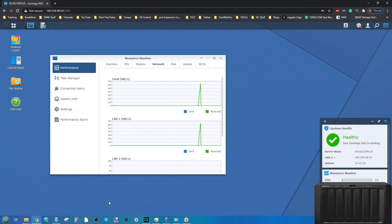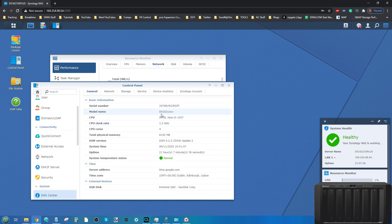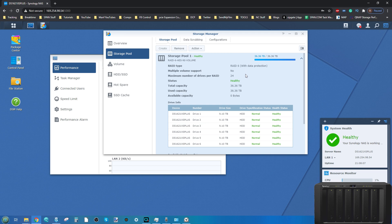There's probably a lot of background noise - fans on the laptop, dedicated GPU, and fans from the NAS itself combined with the enterprise-grade hard drives. In the control panel it is the DS1621xs+, a four-core Xeon-based NAS with 8GB of memory. In the storage manager we can see six WD Ultrastar 10TB enterprise drives. I've not enabled caching - that's for another video. These six drives are in a RAID 6 environment utilizing btrfs volumes with encryption enabled.